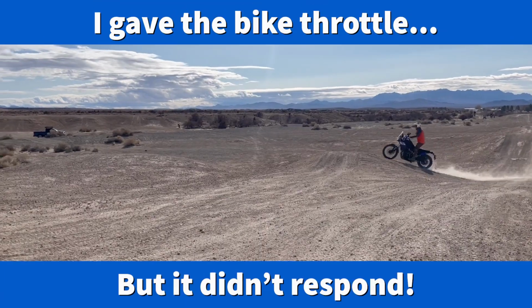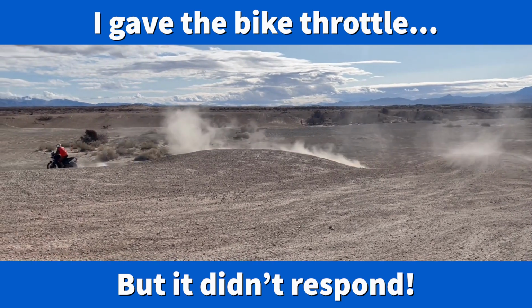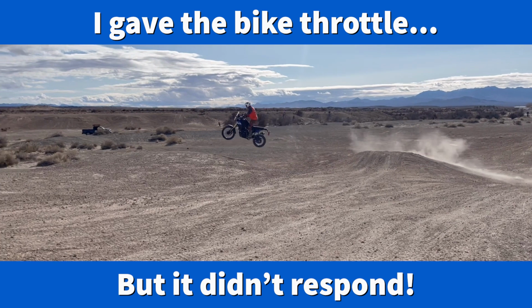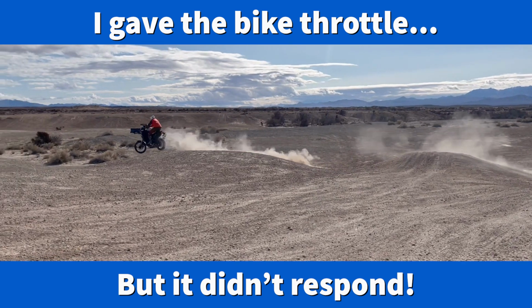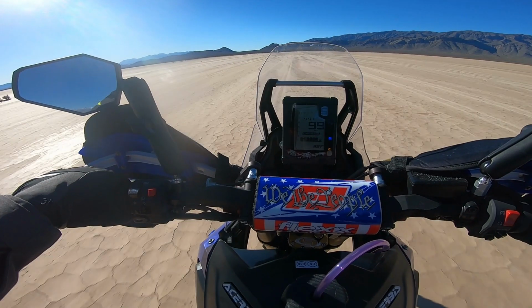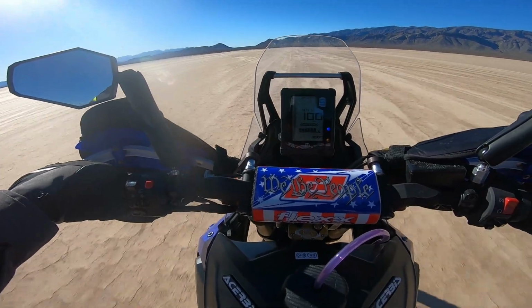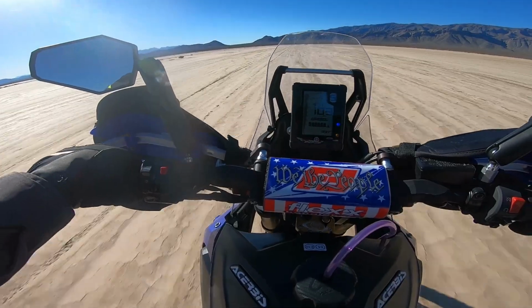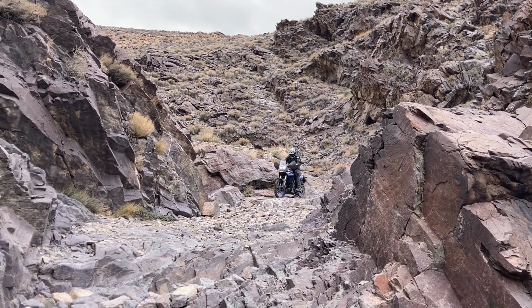It was actually something I couldn't find on my KTMs. I found it on the KTM 1190, but on the 1090, I never got it because the emissions compliancy changed. And of course, this bike is in the same category where it can't be dirty when you give it big blips of throttle. And since this has a cable throttle, it's turning the butterflies, but it has to be careful about how much fuel it throws in there. So it wants the bike to run but not stall, but it's not giving me the response, which affects the suspension, blah, blah, blah, too technical.